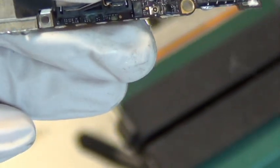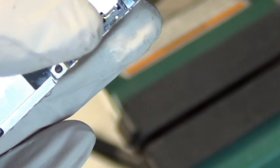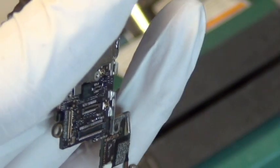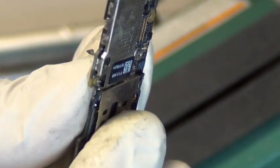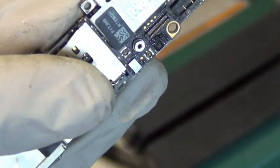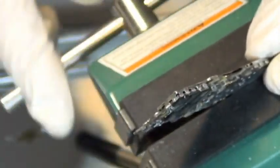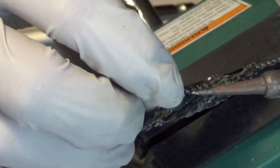Okay, as you can see, I removed half of the board, thank God. There's two more, since this video is primarily dedicated to removing the metal shield. Another reason I had to do this for this logic board is because of the extensive water damage and corrosion on it. Whenever you have a water damaged logic board, you need to take it apart and clean it. You don't want the corrosion to get any worse, or if it's already happening, you want to get it off so you don't short something. So either way, I had to remove these and clean it with isopropyl alcohol. But this video ended up being a really nice tutorial to show you how to remove these annoying metal shields,